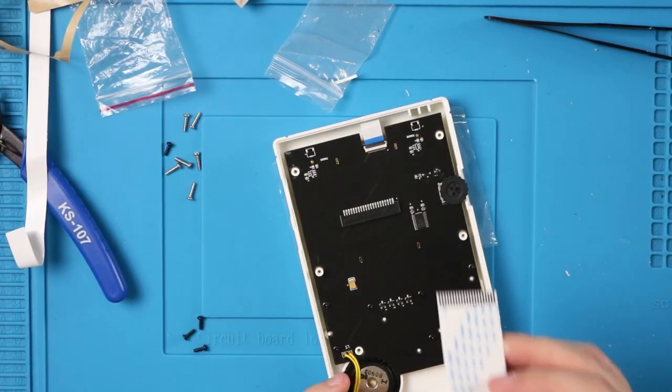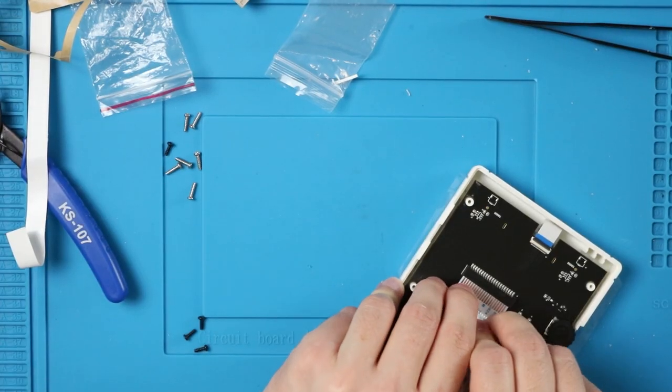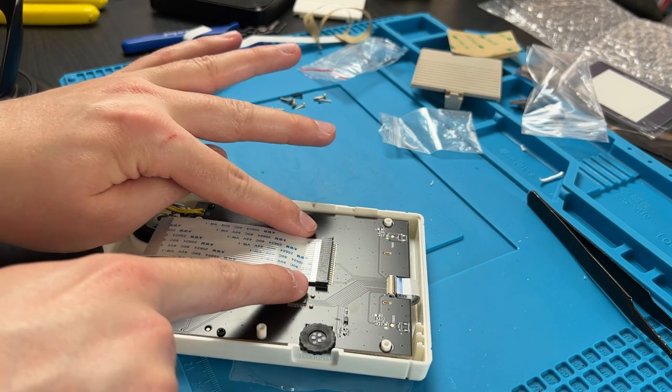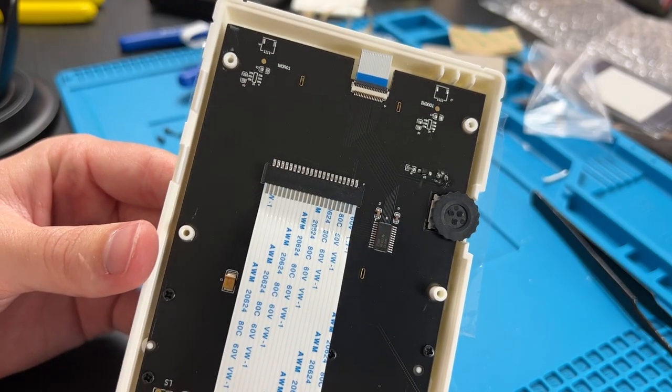And now time for the last ribbon cable. This is the fat ribbon cable. Honestly, trickier than anything else in this, besides probably the trimming. Both are gonna go in pin side up. Stick this in like this. It's not easy, so take your time. It almost feels too thick, but it will fit, I promise. Be careful of the corners because you can fold them if you don't have it lined up perfectly, but it should look like this. And then the even trickier part, taking your back half and connecting that.